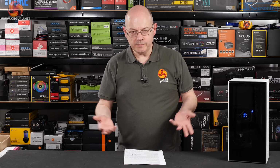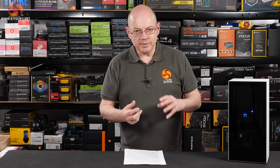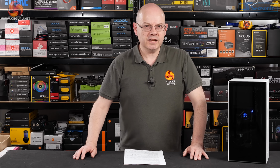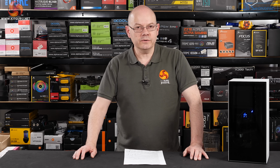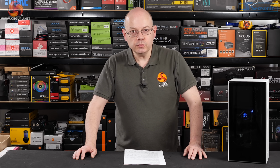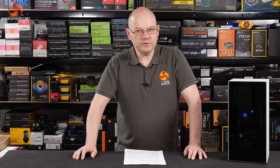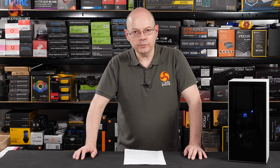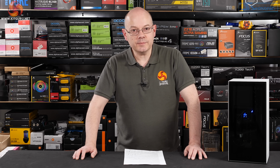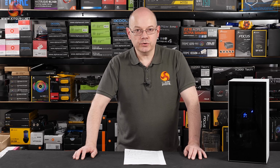So you get your motherboard assembly as I showed you, put it in, put the cooler on, connect everything up. There's not a lot of clearance for the cables, the connections and so on, but there's just enough clearance that it all goes together neatly. Job done. I do have space in here for 2.5 inch drives, and I could, if I chose, install those drives. Sometimes you've got bays and it's just not practical to use, not really. In this instance, yes, absolutely. So I have a 1TB M.2 SSD. I could easily add more storage if I wanted.